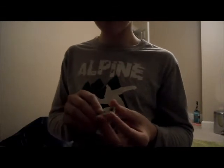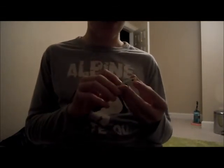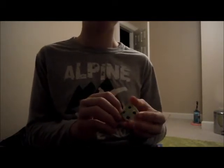Okay. And I don't have this right now. It's actually kind of advanced. If you have any electrical contact paint, and the reason your buttons aren't working is because the electrical contact paint has rubbed off on one of your controllers, what you may try is just painting it back on right there. I'm not going to do that though, since I don't have the paint. But I'm just saying, if you're having that specific issue, it's solved right there. I think you can get the paint on repair websites and stuff like that. Don't know one to be specific, but you could try Home Depot or Radio Shack, some other store.